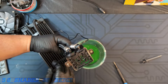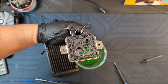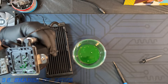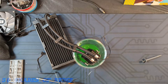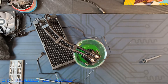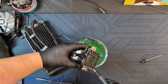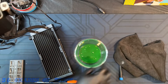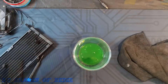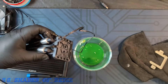Let's see what we're working with pump-wise. I was expecting there to be screws in the bottom but there isn't. Let's see if we can figure a way to get down to the impeller. By the way, if you're working with plastic parts it's really ideal to use a nylon spudger — not a metal screwdriver like I have here. This is not the recommended method to go poking around with plastic parts, but it's what I have on hand. I don't see a seam anywhere — oh, here we go, here's our seam right at the top. Okay, we've got this bracket off — that just slides in so we actually don't have a seam.